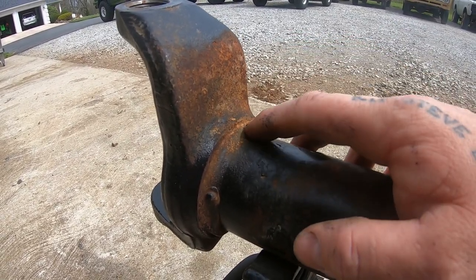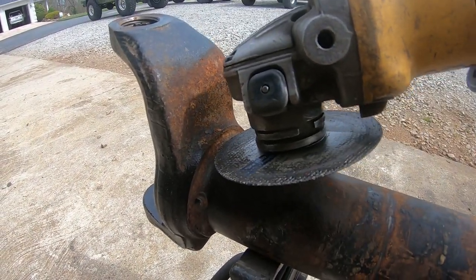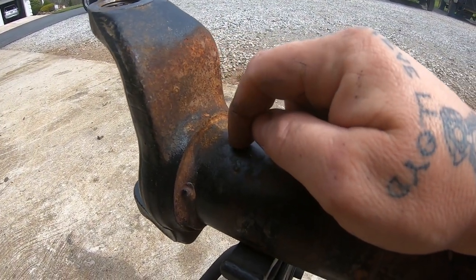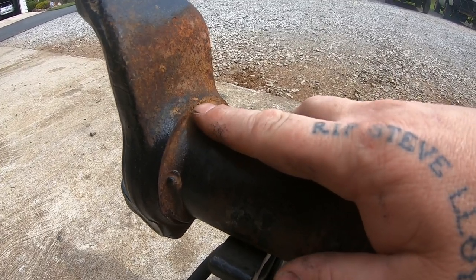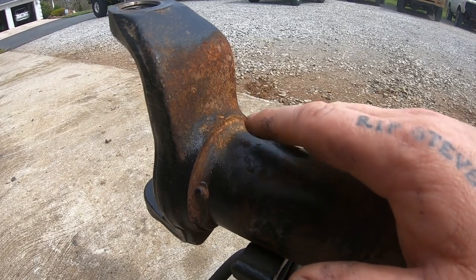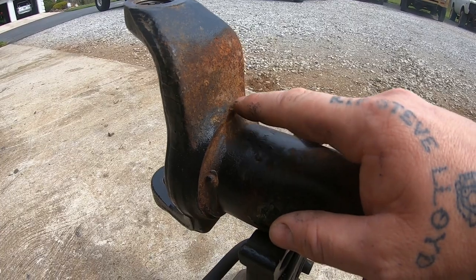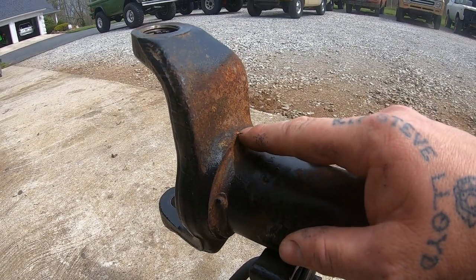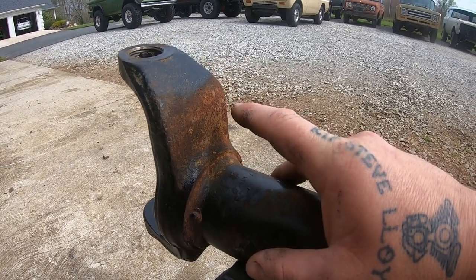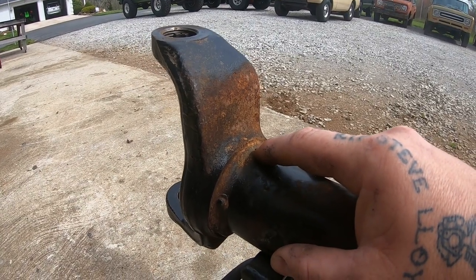But again, guys, I can't stress enough how important the proper angle is coming into this. Too deep, you're really gonna gouge the piss out of this axle tube, which is not what you wanna do. Too shallow, you're gonna be above the crack or the joining surface between the axle tube and the knuckle, and you're gonna miss the mark. So this is really kind of a dance to find where the proper angle is. Like I said, if it's your first time, there's definitely a feel for it, so go slow.